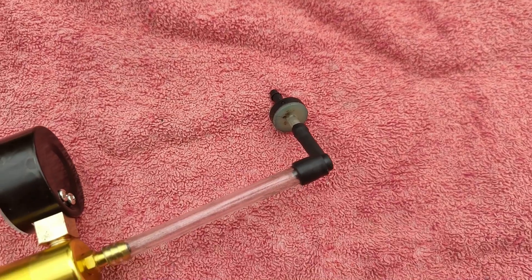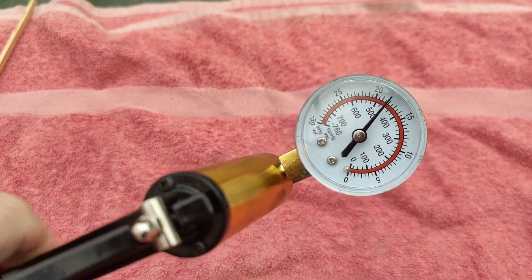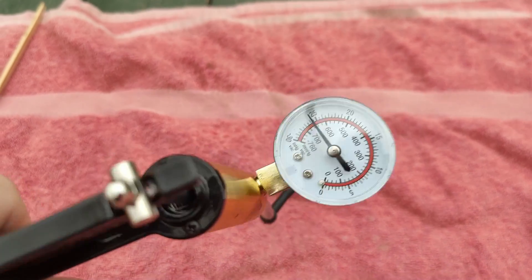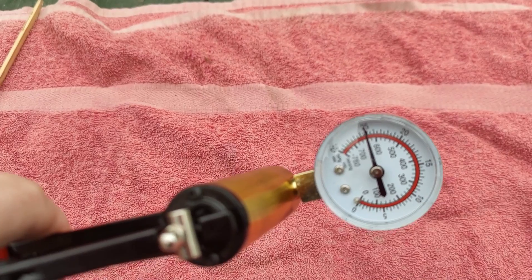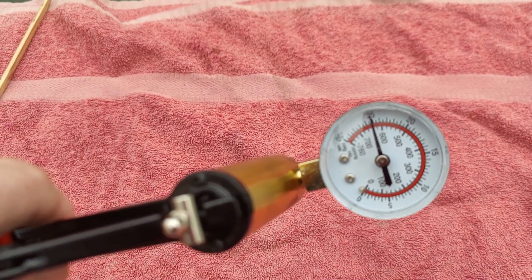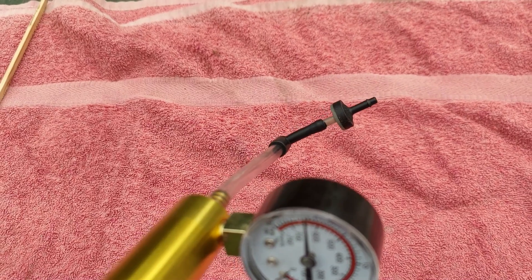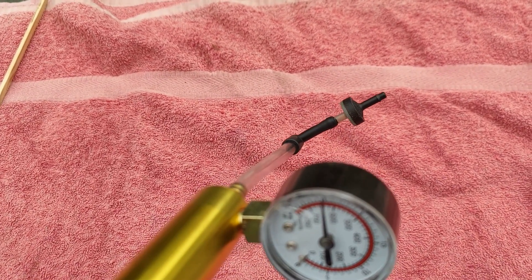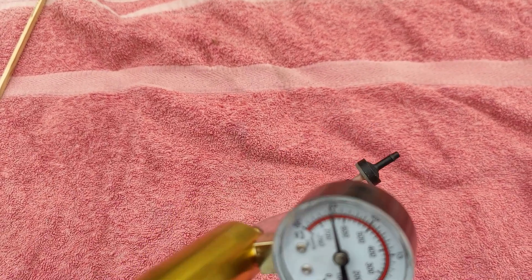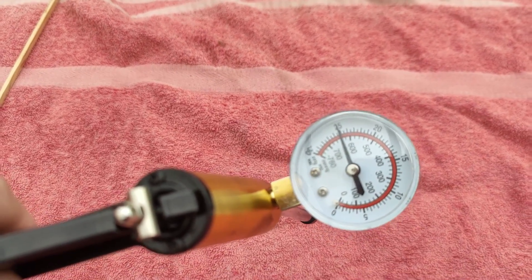So that's the good valve plugged in. I'll pump that up to 25 — that's hard to vacuum. And it holds a vacuum at the white end and obviously allows air through on the black end. So if I tried to pull a vacuum on the black end, it wouldn't work. But that one — that's perfectly okay. Works a treat.